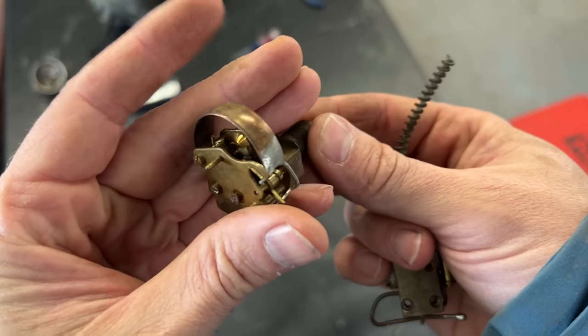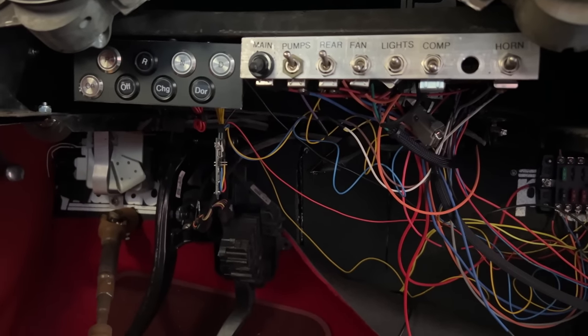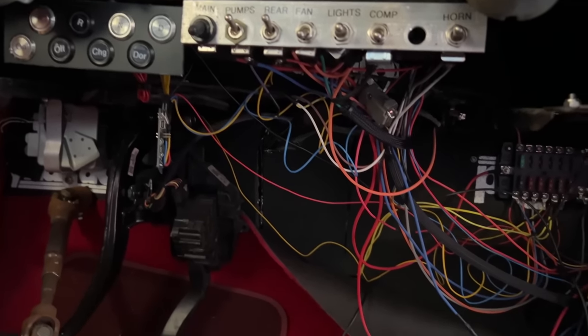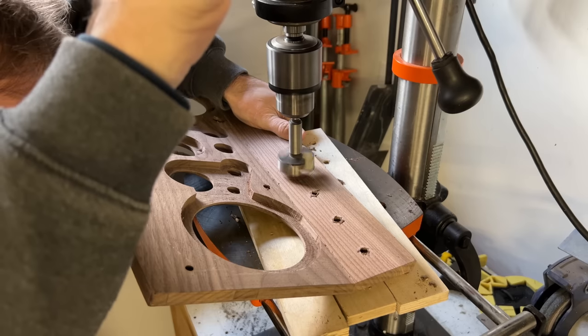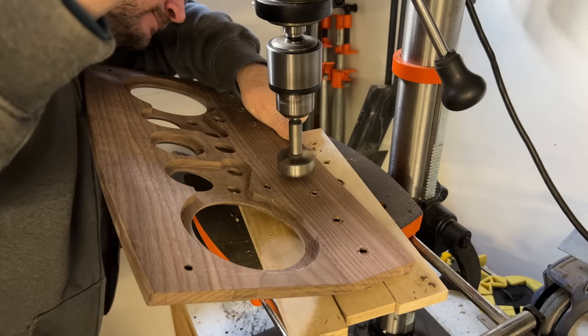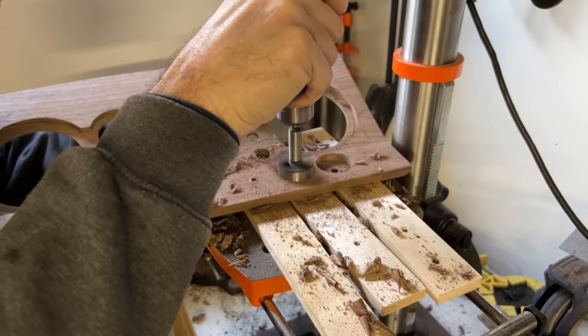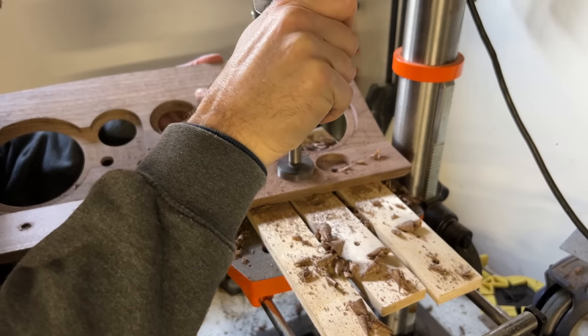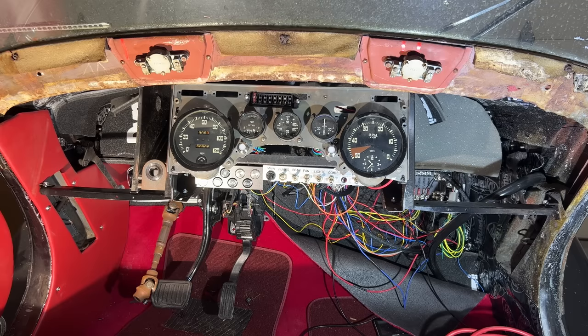I had a makeshift switchboard so I could turn things on and off and switch the car into drive. Nice, but ugly. All of this stuff is going into the new dash, but with switches that feel appropriate for the time frame of this car. I drilled all the lower holes by hand after the CNC since they're at an angle, and I also had to pocket out the rear so shorter switches would fit. I decided to move my fuse block to this piece since it's kind of where all the switches are, so there'll be some rewiring — but that's a problem for future me. Present me has to get all of this in the car, so it's time to test fit.